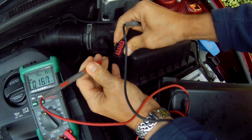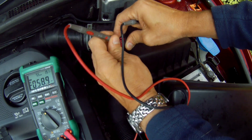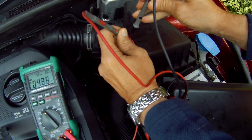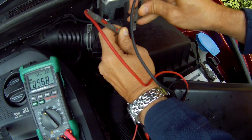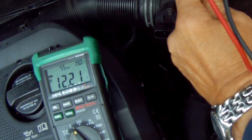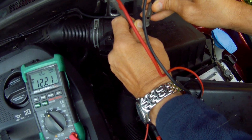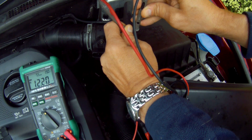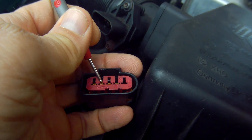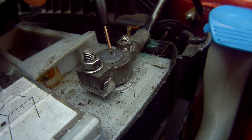If there's still no joy, then you've got to check the cable, and of course make sure the fuses are working. If everything's okay there, test the same connection number two to connection number three — the ground in the connector — and you should get the same 12 volts. If you're not, then you've got to suspect the ground wire hasn't got continuity back to the battery, which you can test separately with your meter set to ohms. Also check the 5-volt reference wire, which should be 5 volts between connection number four and ground on the battery.